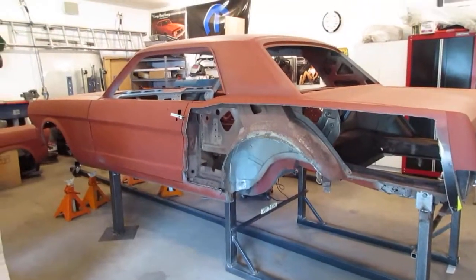By the way, when you cut off all the rear of this, your car will still be held up by the front spring eye braces and those forward braces. So I made those — remember to replace the jack stands, because the jack stands hit the floor and those grab the pinch weld. These are three-by-three steel with a one-foot square base plate. The car sits very nicely on them — you can't shake it, you can't move it. And the car is not heavy to begin with; these things are just ultra light, which is why they make such fun cars to drive.